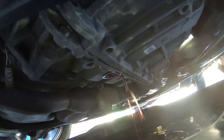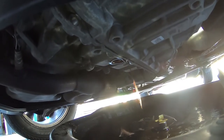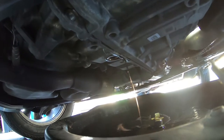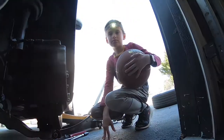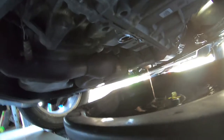I forgot to show it, but where that fluid is leaking out, that is the drain plug for the transmission. So I took that off, letting it drain, and I'm going to let that go a few more minutes, then cap that off and start the fill process. It's probably best if you have a friend or a kid to help with the fill process — we'll get to that in a couple of minutes.